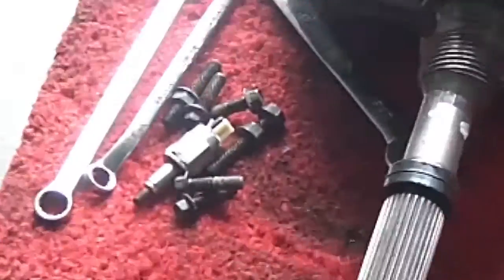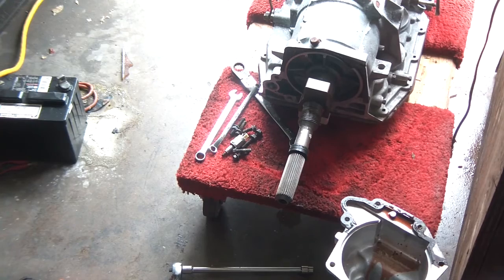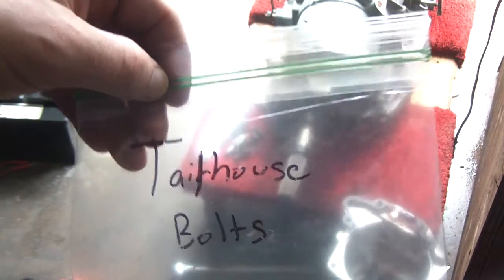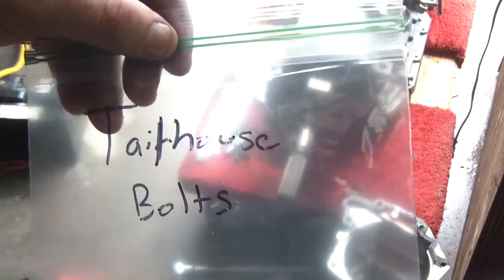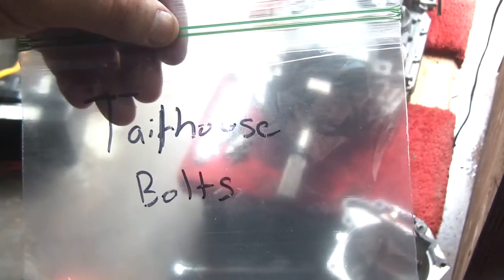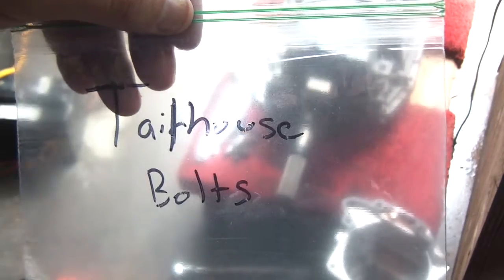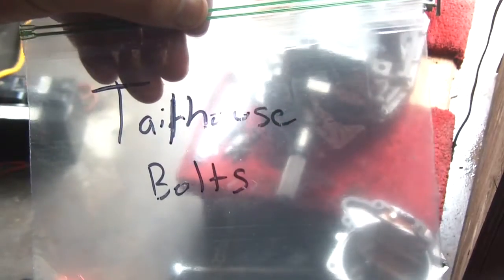All right, cool. Okay, we're back. So I got the tail housing off, got the safety switch sensor removed. One thing about these transmissions is that they're really complicated, but you should really keep all these parts organized, because there's so many parts. You'll see as I start taking this apart that they're just going to be everywhere. And one thing with the transmission, you want to keep all these things as clean as possible. So I'm going to label these different baggies, and most likely I'm not going to reuse these tail housing bolts, but I just want to keep them organized because I'm going to have a bigger bin, and it's going to be crazy. You'll see. At least with the C4, I know it was crazy. I couldn't believe how complicated these things were. The guys that invented these things are freaking geniuses, man. It's crazy.